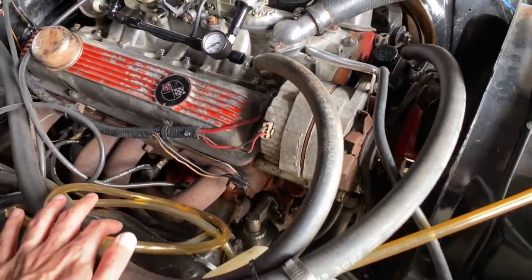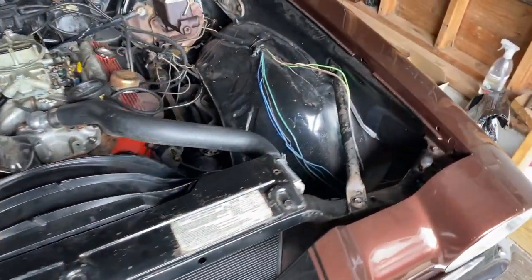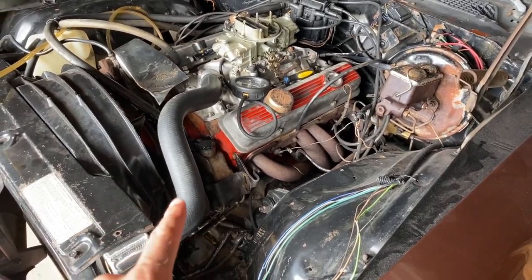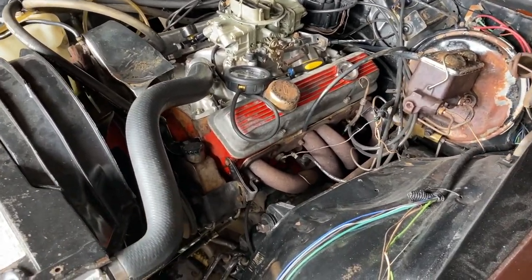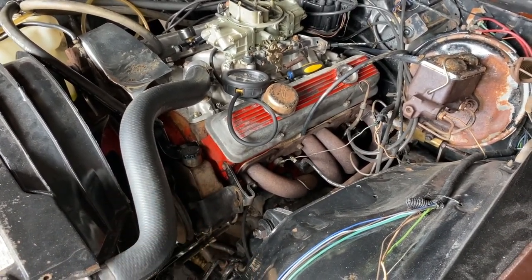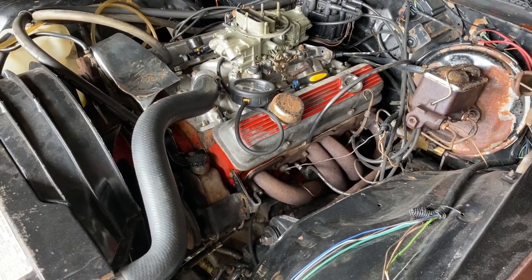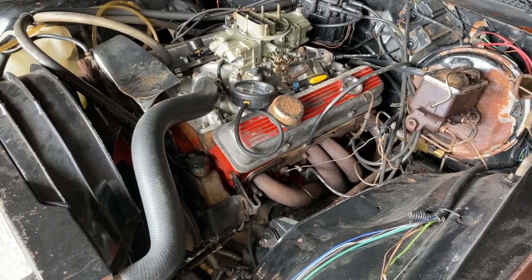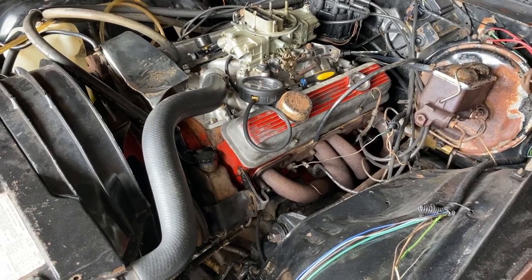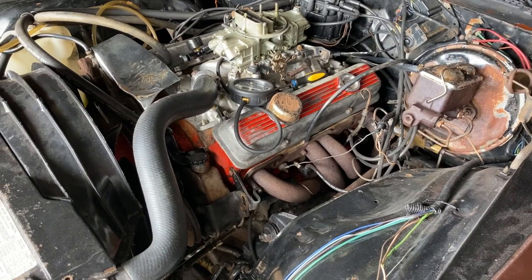A lot of helpful comments on the last video, so I really appreciate you guys helping me out on that. A lot of good mechanics on this page. Another comment that stood out to me, that I was thinking in the back of my head, just kind of reiterated the point. Solid lifter cams, I was running just normal oil, and I was thinking about how the zinc content is super low in today's cruddy oil. So maybe I did wipe a lobe off on this cam because I didn't add a zinc additive to it. I wasn't thinking at the time when I was starting this up. I probably should have added a zinc additive on top of the oil when I replaced it for the first startup, because it just started misfiring all of a sudden.